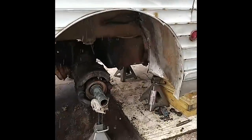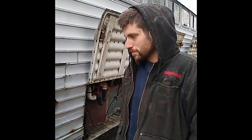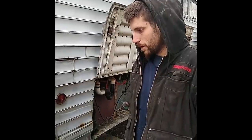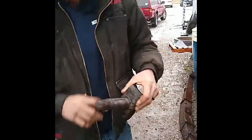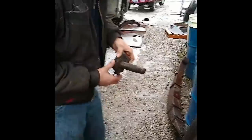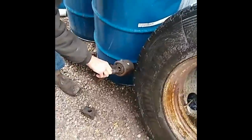Chris Carter, who has his own channel — I'll link it in the notes below — has been working on this bus since we got it to Indiana. The biggest project so far has been taking the springs off. He relayed how much fun that was: he'd never messed with anything that had threaded pins for the bushings. Here's one of them — this is the pin that goes through the leaf spring, and in the leaf spring itself it's threaded where your bushing is. So they thread in and out.